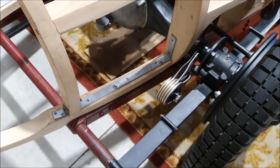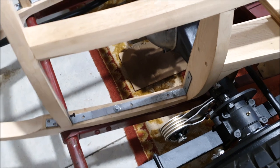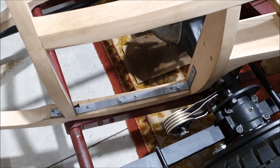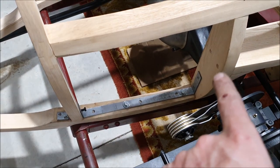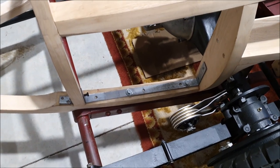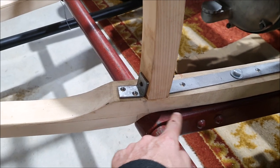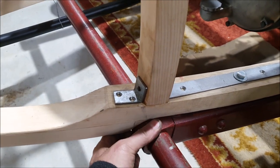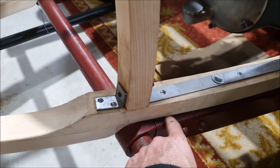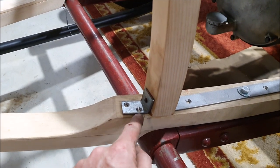I made the back pieces first and wasn't confident about bending the angles, because everything on this car is at a strange angle - nothing's at right angles. So I did the back ones in two pieces, bent each separately and welded them together in the middle - once it's all painted you won't really notice that. I extended the woodwork just here slightly to round that off so when I do the body it's not just a square corner - I'll be able to hammer that round nicely. It's sitting right on the chassis at the moment but remember it will be sitting up on little rubber spacers.